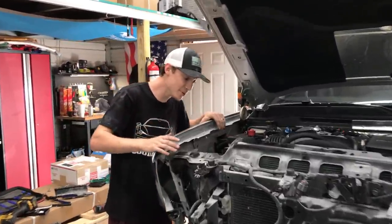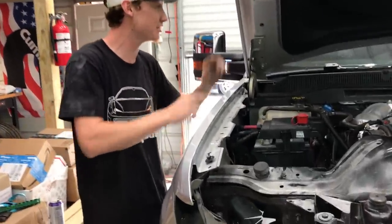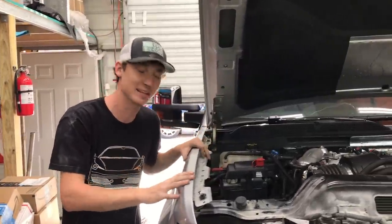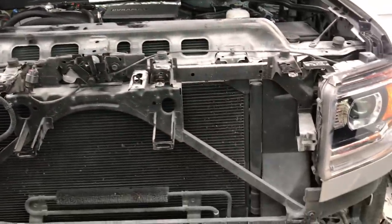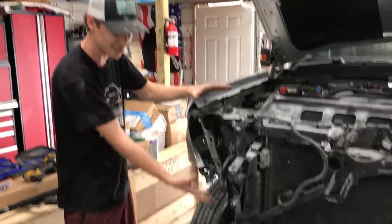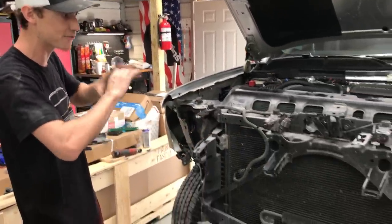We just found some more damage behind this fender. It looks like a few brackets are actually bent under here — this bracket, this bracket, this bracket — quite a few brackets just behind the fender. We're actually not going to remove this fender because we found out that the hood is actually bolted on to the fender. We're going to wait till our new fender comes in because we don't want to leave this truck with no hood since it is going to be parked outside — don't want any weathering or rain on the engine. So we're going to pause on that and move on to this front radiator support. We're going to try to pinpoint our radiator leak or coolant leak — it could be something simple like a hose, or the radiator could actually be busted.